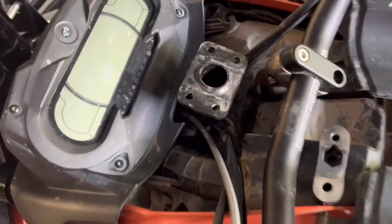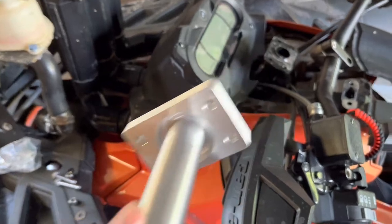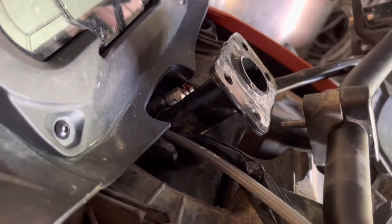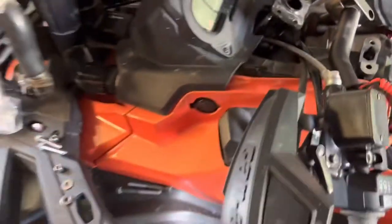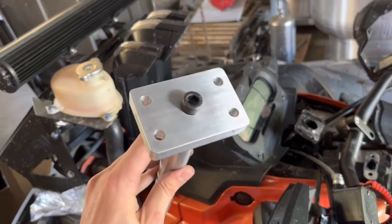The top plate has four clearance holes for the four bolts that hold your bars on, and there's a counterbore underneath to clearance that protrusion on the stock stem where it comes through with the welds. Then there's a clearance hole for the bolt on top, which I put red Loctite on and tightened up, so hopefully this stays one piece in assembly forever.